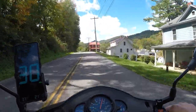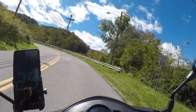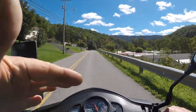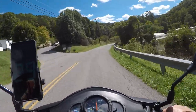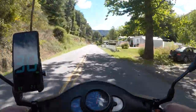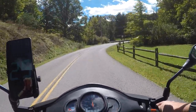I'd say bang for your buck, the roller boss is probably one of your best upgrades. Like I say, it doesn't affect your RPM, so you still got your rev limiter, so you're not gonna go over a certain RPM. I'm assuming around 5 grand. Rev limiter will let you go up to at least 6. And a lot of people say it'll cause extra wear and tear on the motor. I don't know. I'm still thinking about doing it, but before I do that, I'm gonna focus more on the carb jetting and airflow. Give us a little more up so we can make it up over these hills. That's more important to me.